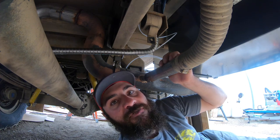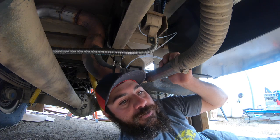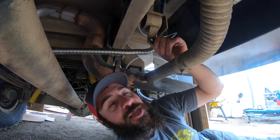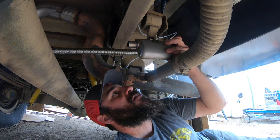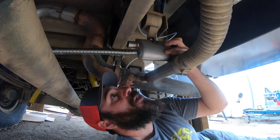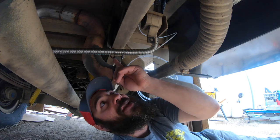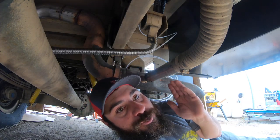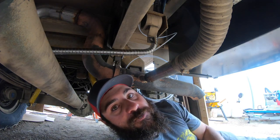I don't think it's going to be too hot. It produces a hot off-gas, but it's not as smoky or as intense as I would have thought. So I think this would be a good location. This was a factory exhaust hanger, and I think I'll hook this guy right here onto it and then plumb him in. I'll probably do a turnout that'll go back down with the grain of the chassis — that way, as you're driving forward, it'll keep stuff from getting venturi-affected right into the exhaust muffler.